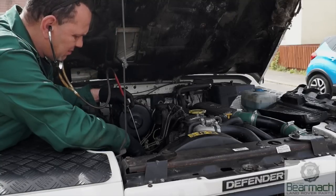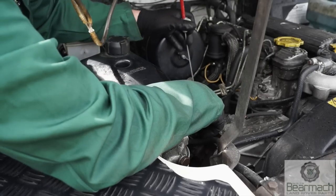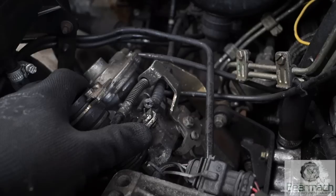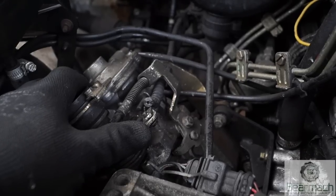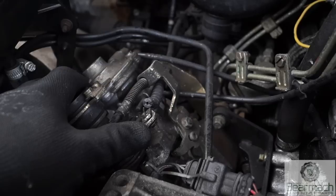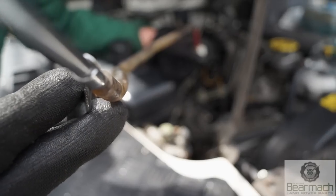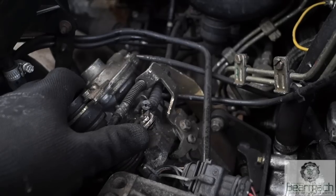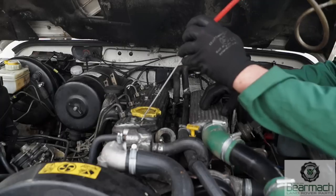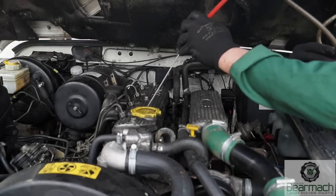Components make noise. I'm now testing the lift pump, which has a chamber on the top, and it has actually got a tapping noise. I've put the rod straight on there, putting the revs up a little bit and listening to what happens. This could well be a weak spring in the lift pump. If you couldn't quite hear it, have another listen to that clip and see if you can hear the tap tap tap.